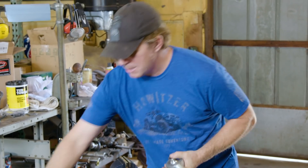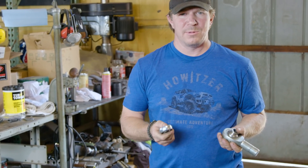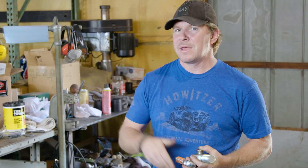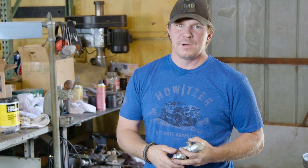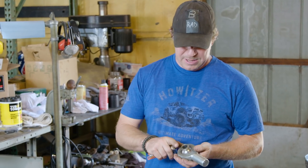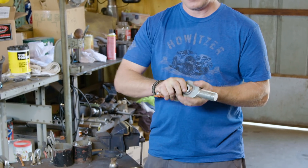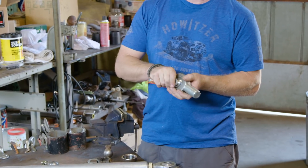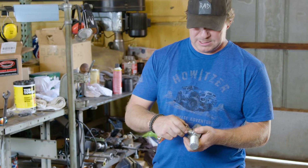This is by FK, and this is also by FK. FK is probably one of the best that you can get. There are other companies out there — there are really high-end rod ends and there are low-buck cheap versions that aren't going to last very long. There are different grades, which depends on how tight it is, how well it's sealed, how much it will flex, whether you're using misalignment spacers or high misalignment spacers. Some of them have the misalignment integrated right into the ball inside.